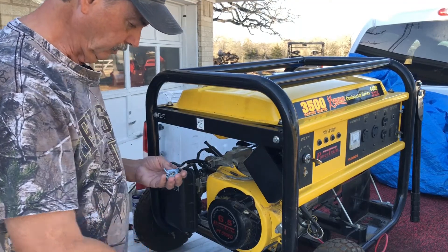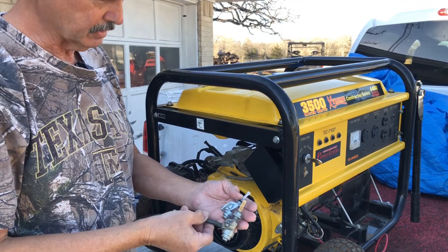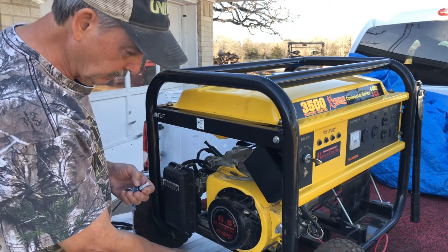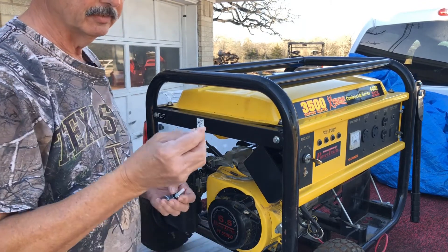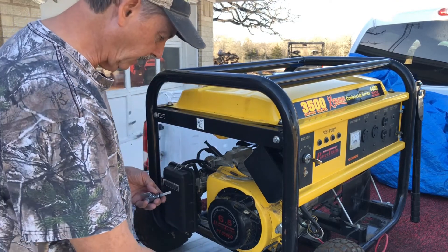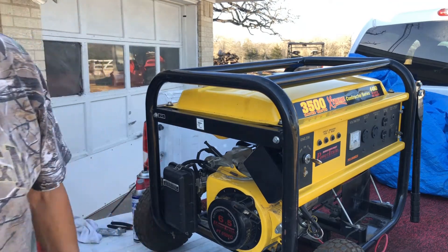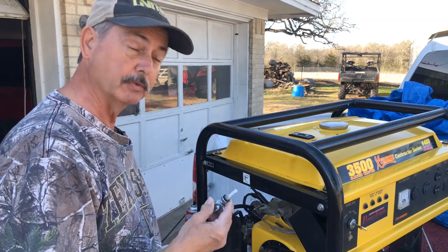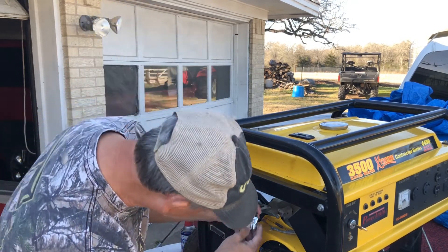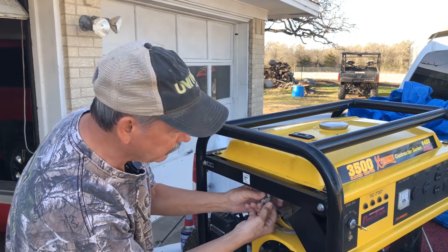Our new valve — we're replacing the one that was leaking. You see it looks just like it. Got the same little nut on it, got the little washer. The other washer had deteriorated so bad that that's probably where our fuel leak was — just that. But we're gonna go ahead and put the whole thing on, get the hose on. Luckily the new valve came with a new gasket on it, so we're gonna screw that in, tighten it up, and then get our hose put on here. All the fuel is out of it, so we don't have any fuel in it right now.